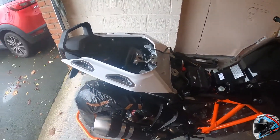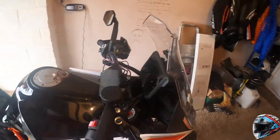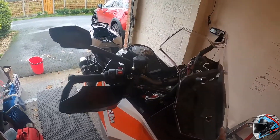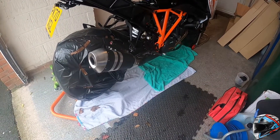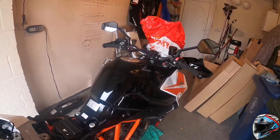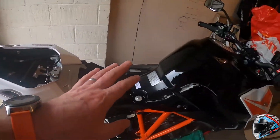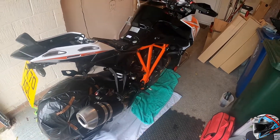Make sure you take your seats off — the last thing you want is oil on your seats. Likewise with the rubber grips. I'll be protecting the screens but making sure I avoid them, along with the glass. If you do get ACF 50 on the plastics, it's no big deal — just wipe it off, it doesn't have any lasting effect. Also worth noting, ACF 50 is fine on electronics, so don't worry about covering connectors and wiring. It's all good with ACF 50, so all ready to go.